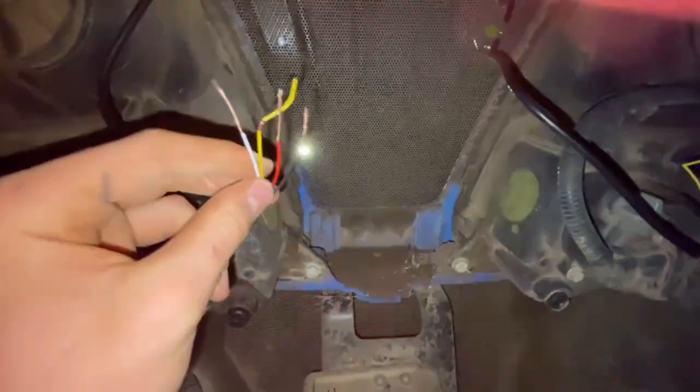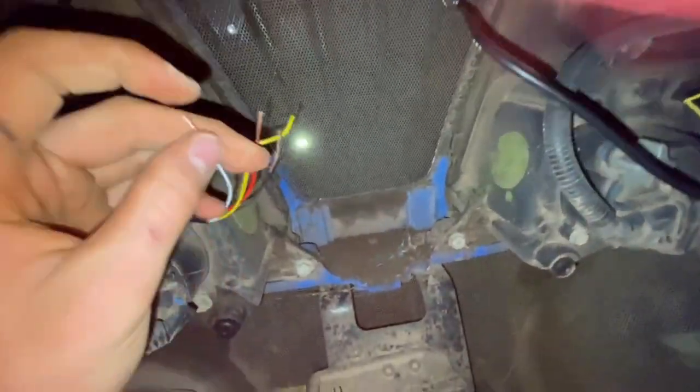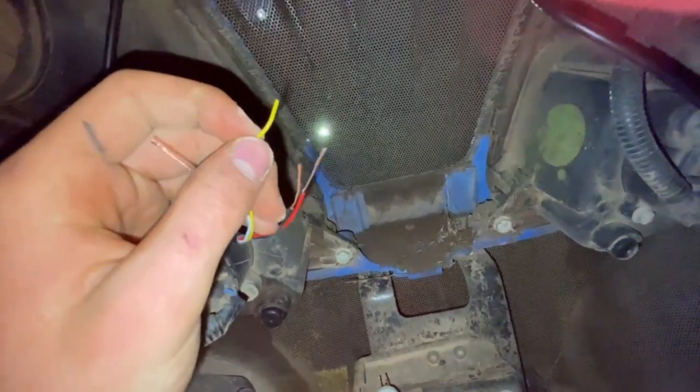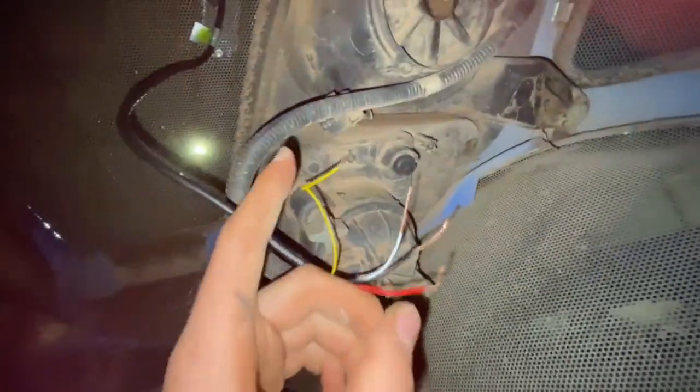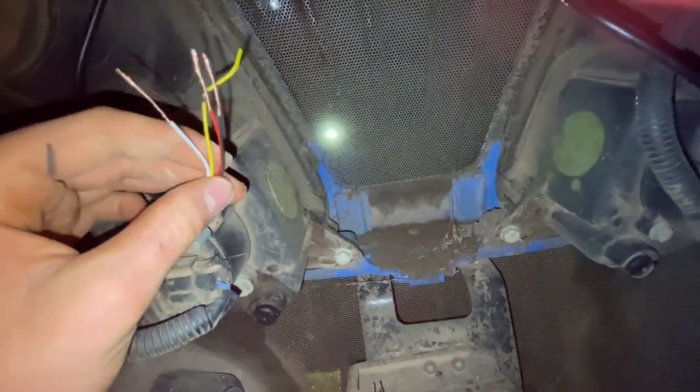So I'm on with the wiring now. I'm going to wire white to white because that's synchronised, so they flash together at the same time. My red is positive, black is negative. The yellow is the switch mode wire but I'm going to leave the cap on and fold it back because I'm not wiring a button in for switch mode - so they just stay on one mode. Then I wire it up through this harness, cable tie it to the harness, down into the back and out underneath the cab.